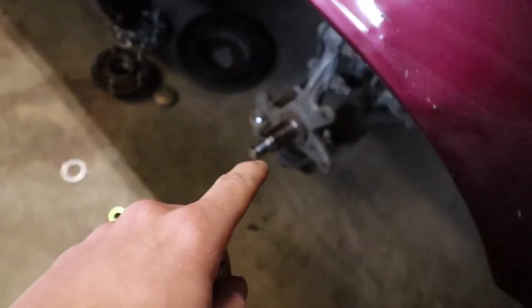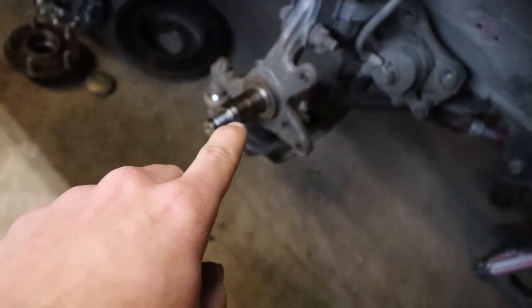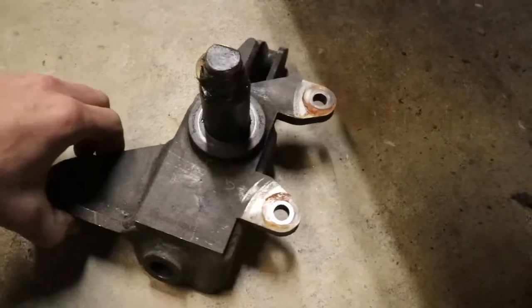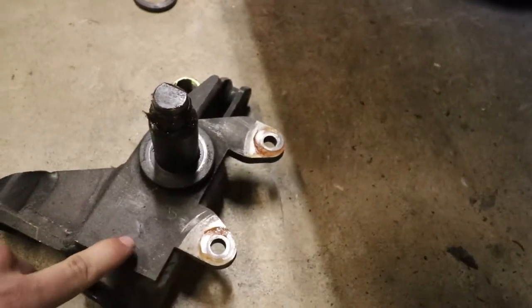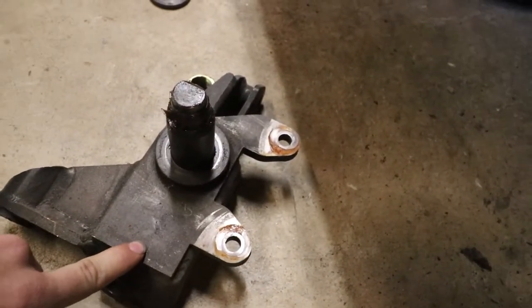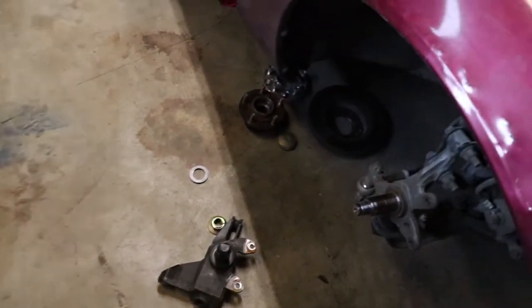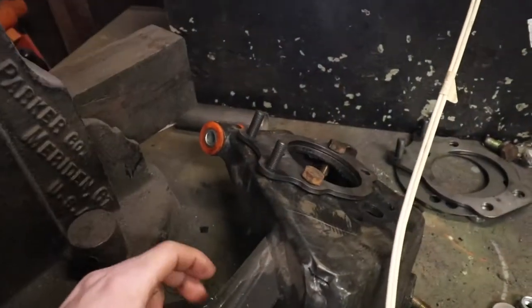So if you look down here, I'm taking the knuckles off right now. I actually have this knuckle right here that I'll be using this year. This is the Driftworks Geomaster 2s. They're a 55 or 50 mil drop knuckle. So that's gonna help fix my geometry up front, as well as I have them for the rear as well.